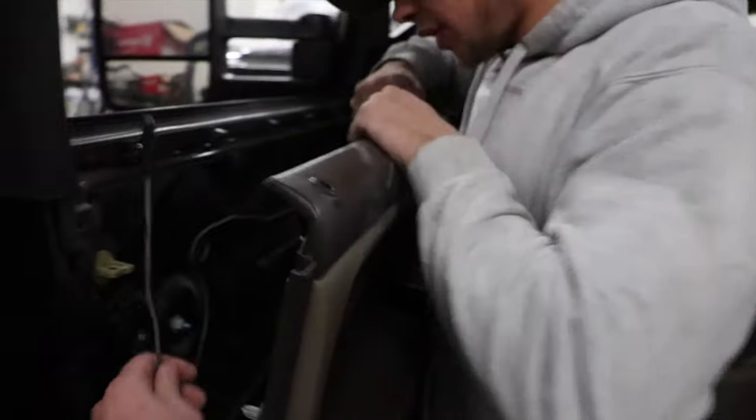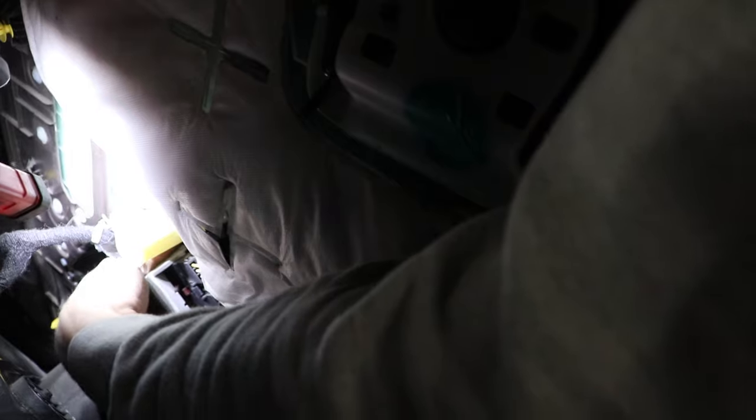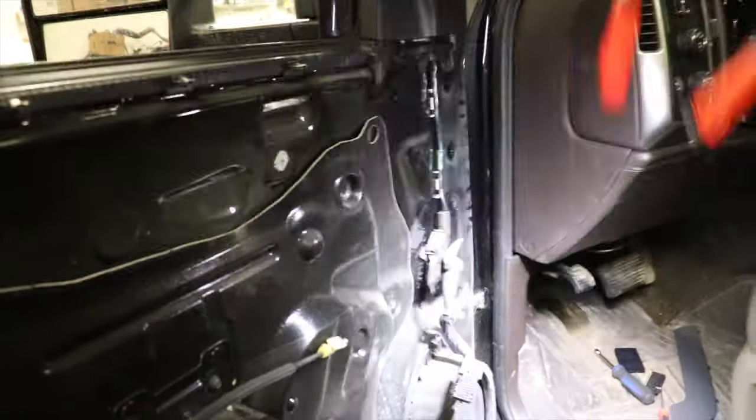Okay, so you're gonna have this deal here, which is your door handle. You can see there, push this tab down, pull it back around it, and it pops right out. Simply pull this red lever back, push the tab in, and take it up, and then it pulls on the back side. Actually, that's only one. And that's it. There's your door panel. And then, of course, the mirror plug-in's right there. And then this here just snaps off too, this piece above the door.